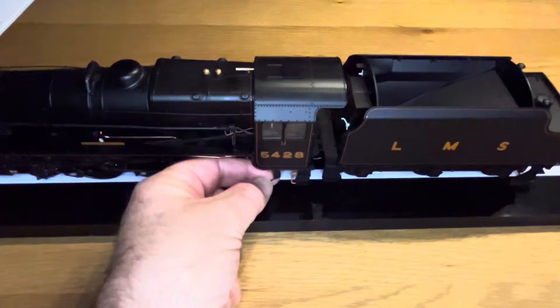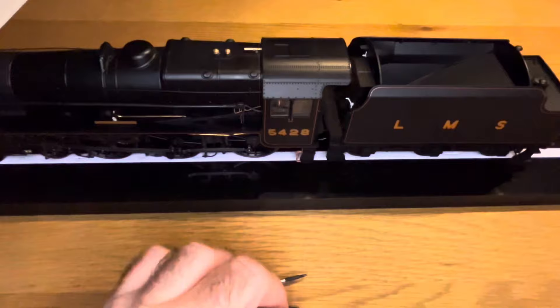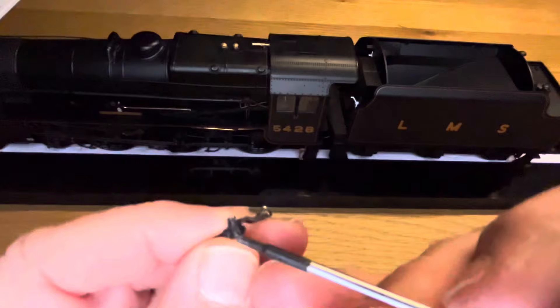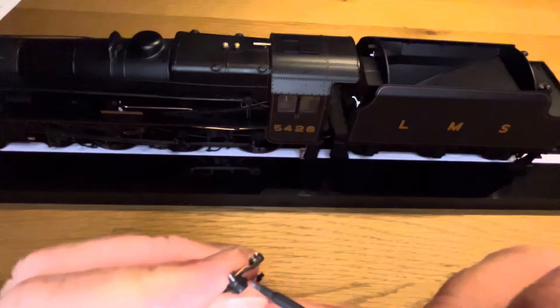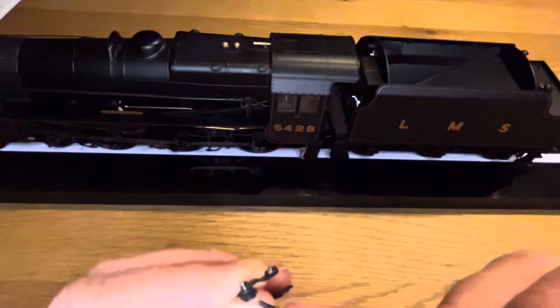I'll try to show you now where the problem is. The speedo cable locates into the body just here — there are two holes just underneath here so it would be super-glued into place. You undo this screw and this part then fits in there; there is a small knob to engage inside, and then you replace the screw. The problem is this little protruding part here — it needs to be flush, because as the rods rotate they snag here. Just make sure this isn't protruding; it should be flush, as you could damage the rods or the gear by putting undue pressure on them.